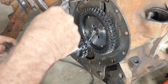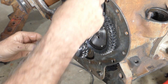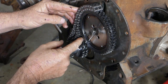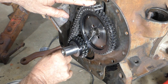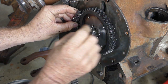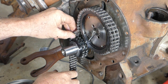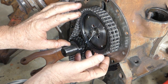In the book they say to double the chain up. So we're following the book roughly — what they're saying is take the sprocket, double the chain up, bring it halfway around, and make sure it's sitting in the bottom sprocket tooth correctly. You can see that it's not sitting on the tooth; if we pick up the tooth we've got nothing. We need to do this on the top as well.